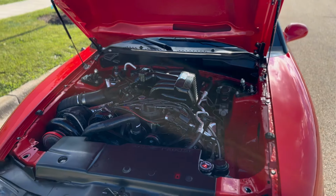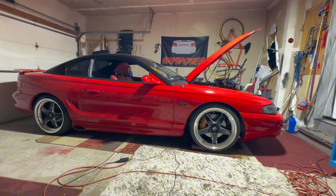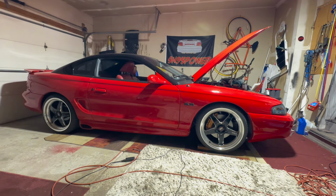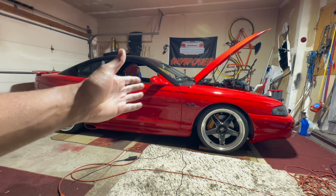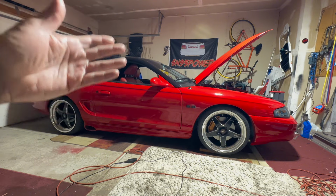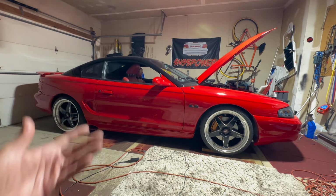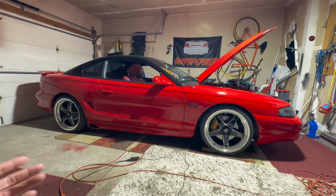It's kind of disappointing. All right, back to the crib, and I think we have a problem with the Chinesium aluminum radiator. It seems like the coolant temperatures have gotten worse with that radiator in here. I can smell the coolant still, even pulled into the garage. So we're gonna yank that out.